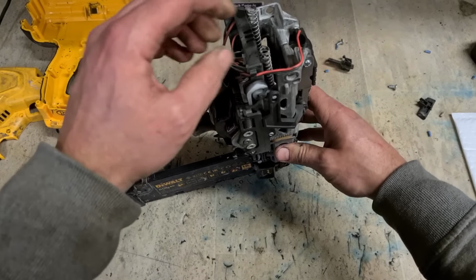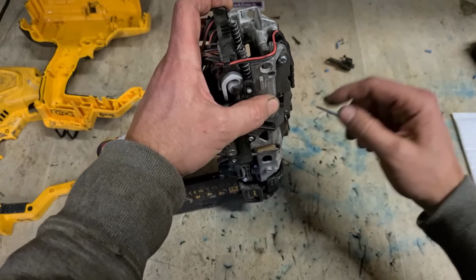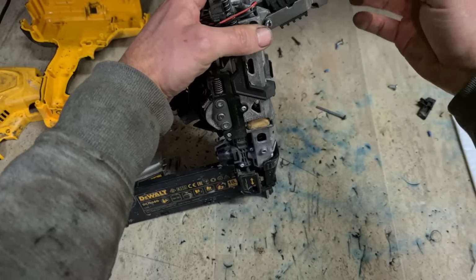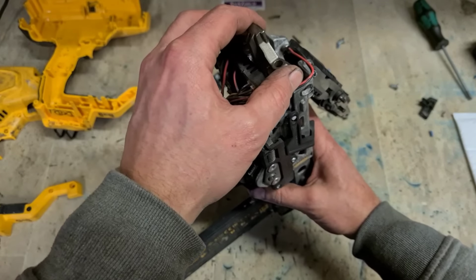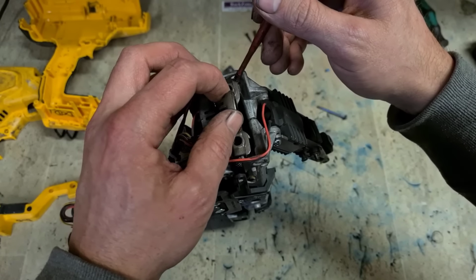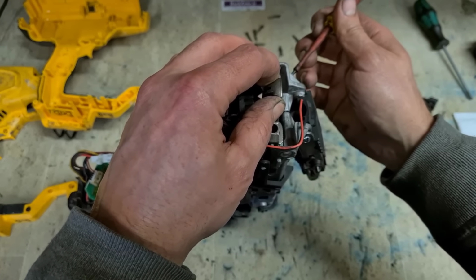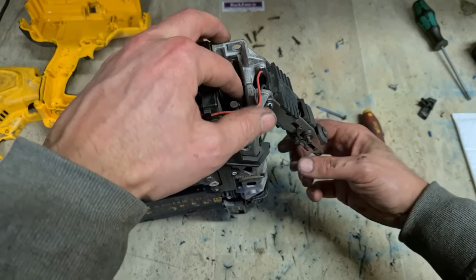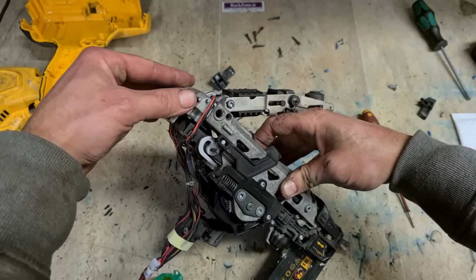Change this part, isn't all that complicated. Just down inside of here. Pull out that pin for a bit of access, so that you can actually lift up this axis. Help lift it, just back out these screws. Just a half a turn. You can lift that up. And it's just a matter of lining this up with these here rods inside and springs. Then feed the actual pin into the holder down here. You can push this back, hold it with your finger, and take your end assembly, push that on.